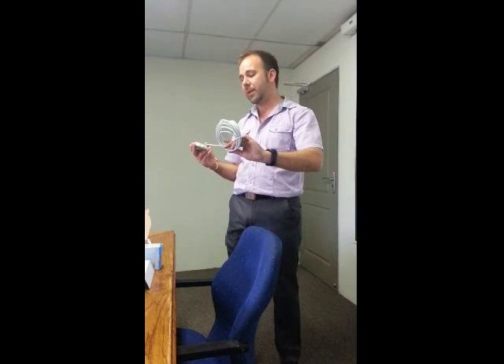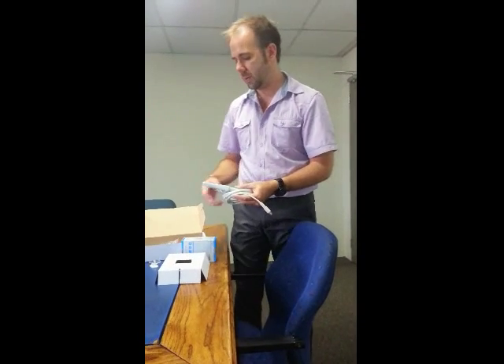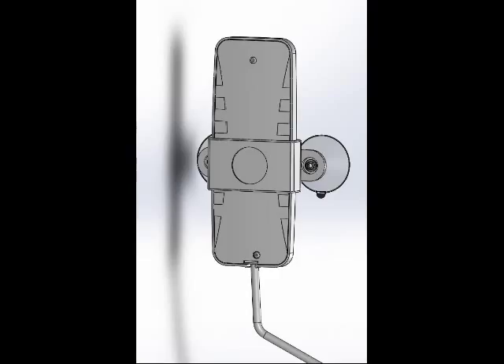It's got a 5 meter USB cable attached to it - 5 meters because that's the limit of the USB standard; it can't go further. The first option is you can plug it directly into your laptop's USB port and it functions like a normal modem. It installs a native unbranded app on Windows and you can connect to your operator. This modem has about 5 different mounting options: desktop, window mount, outdoor, wall mount, and pole mount. The most effective one is the window mount, because it's the easiest and most versatile, and has the biggest impact with the least amount of effort.